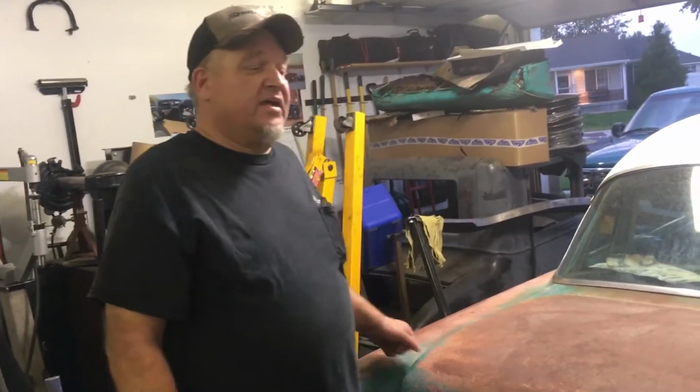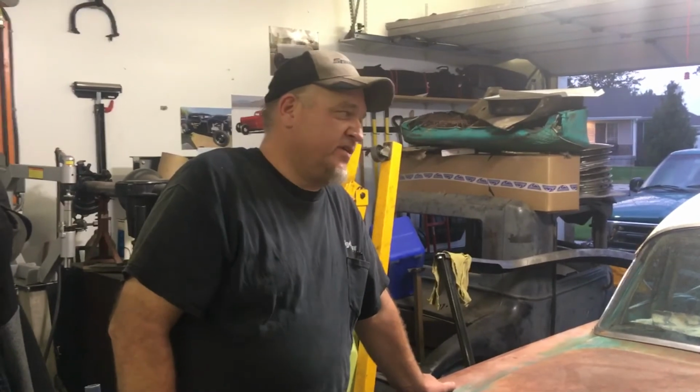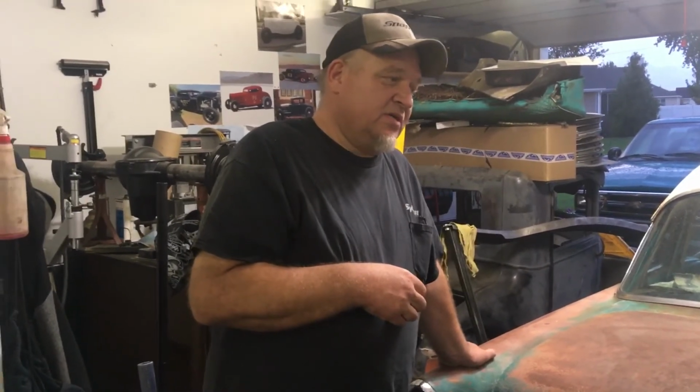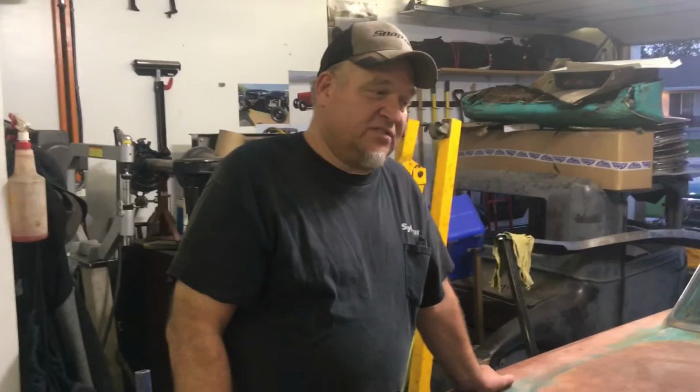So anyway, that's just some tips and tricks if you're ringing wiring out on any old car. It doesn't have to be a 55 Chevy, but grounds first. Go to your grounds. Always go to your grounds. And when this wiring is this old, you gotta look at it pretty close, because the insulation on it will crack. You'll get bare wires in spots. You don't want to go through getting a car running and get it back on the road only to have it burned to the ground because of crappy wiring. So wiring is important, especially old aging wire like this. So pay close attention to it when you are going through it. Make sure that there aren't any bare wires. If there is, fix it.